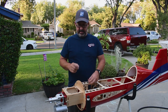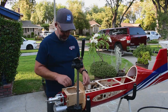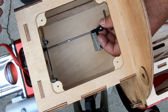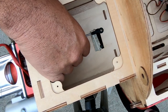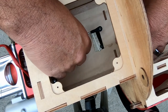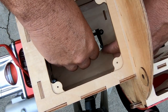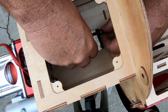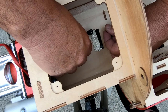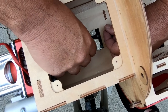I'm going to set up the GoPro with an over-the-top view so you can see what I'm talking about. Our pushrod is already connected to the carburetor — I connected it with Loctite before mounting the engine. I looked at the orientation I wanted the servo in, and I'm going to end up with the arm coming backwards. One nice thing about this Xtreme Flight is the servo is sideways, so the center of the spline on the output is going to be the center of this hole. I set my pushrod length so that's all the way closed and that's all the way open, and it's even — it lines up with the edges of the servo, so I know it's traveling a similar amount in both directions.